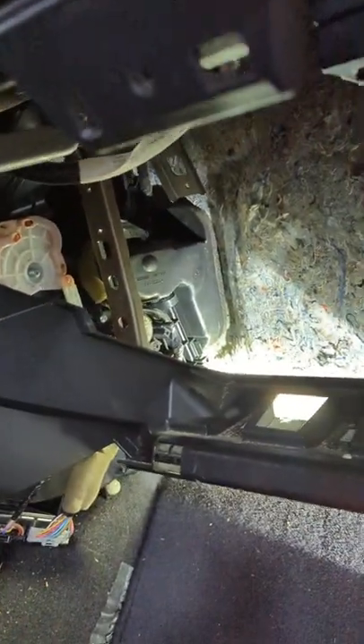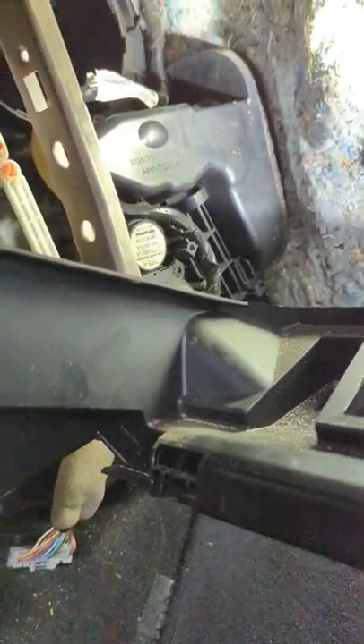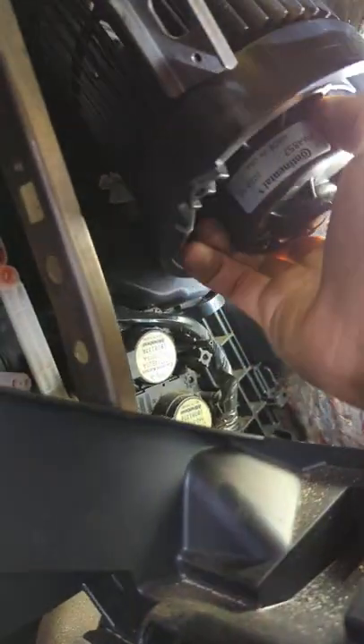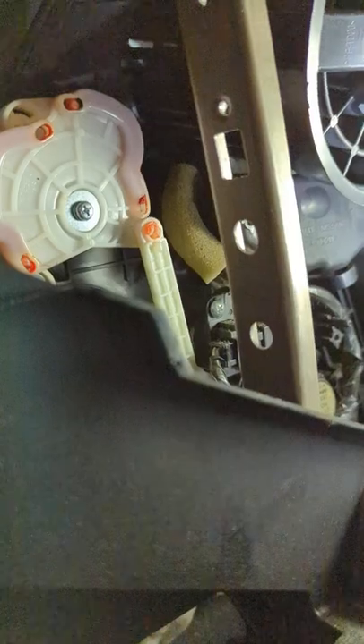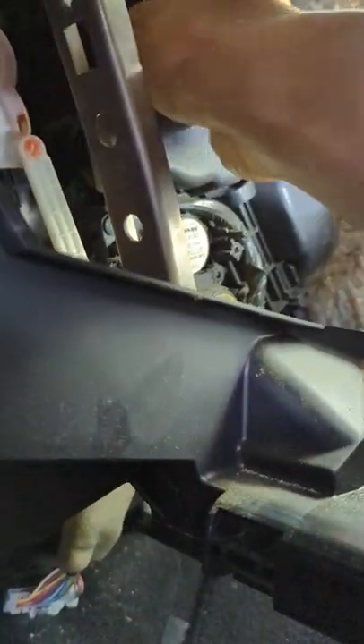It fights a little over here. Here's the old blower fan — the new one goes in the same way. We're gonna put the new fan in here; you gotta pull the harness connector out of your way, and pretty much this piece out of the way. Wiggle, wiggle, wiggle — make sure it lines up.